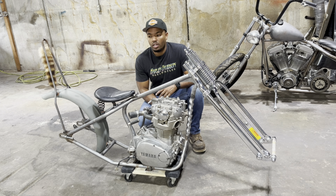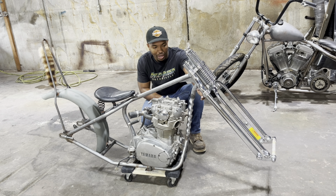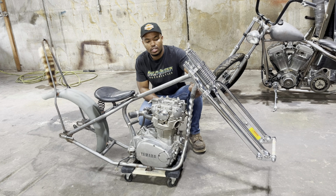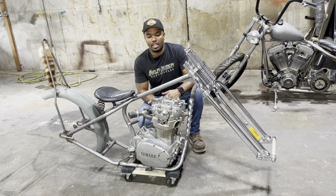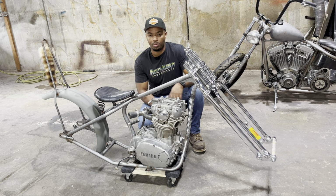It was 4 under. It was just way too short. I had a bunch of sag in the front side of the frame, so I actually took the time out to do the measurements and the math. And the 22-inch stock should give me quite a bit of raise to get this front end up a little bit. So.